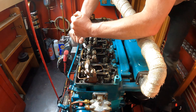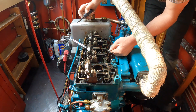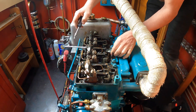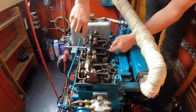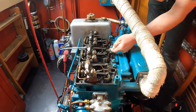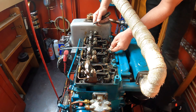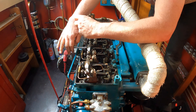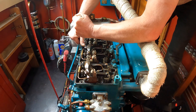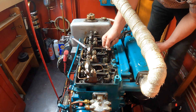So we put the spanner on there, just crack that off, go up a little bit. I've already screwed that in just a touch. Then we just want to feel it — you don't want to put it down so that it's causing the valve to open; you just want to feel it drag. A little bit more... there we go. Just feel that starting to drag on there a bit now. You could do it too much, where you have to force it in — then you'd literally be forcing the valve down to get the feeler gauge in, which is incorrect. There you go — that feels a little bit of drag. So now we just have to keep that screw very, very still — perfectly still — while we lock it up.